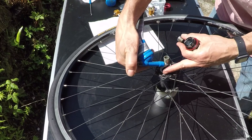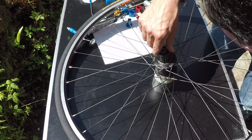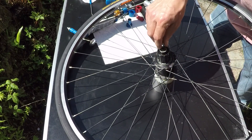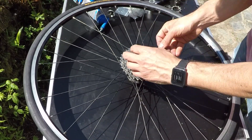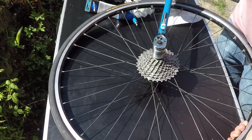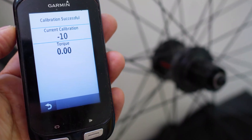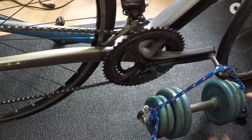Make sure everything is clean. Place the red seal into the free hub body with the notch to the free hub. Add some more grease to the axle and slide on the spacer and the free hub. Attach the end caps and the battery cap. Finally, reattach the cassette and tighten the lock ring. You can then check everything is working okay — as long as you don't get a calibration failed and the torque values are zero with no load, all should be well. But if you're unsure, test with the known weights method or send off for recalibration as mentioned earlier.